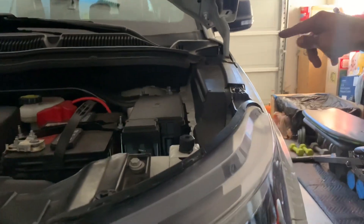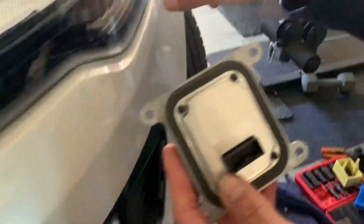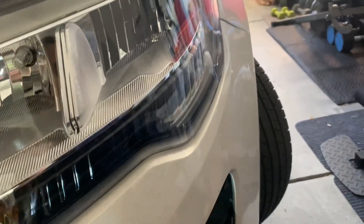After I checked the fuses up here and under the steering wheel, all fuses are good. So I went ahead to see if it was a light bulb that was burned, but it turned out it's not the light bulb — it's the LDM module. This is the one that went bad, which kind of makes sense because it digitalizes this part and the little light that goes inside. So I ordered a new one and I'm replacing this one here. As you can see, this is the same one.